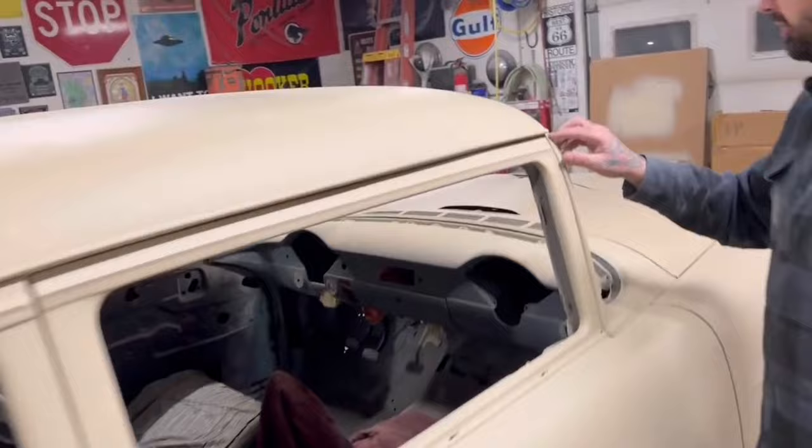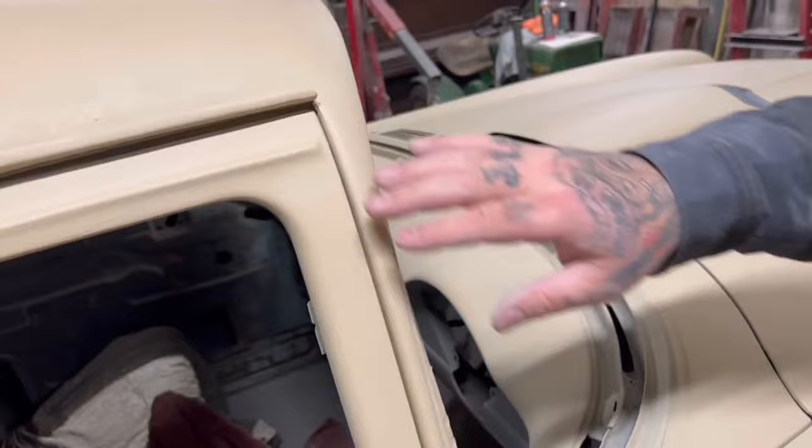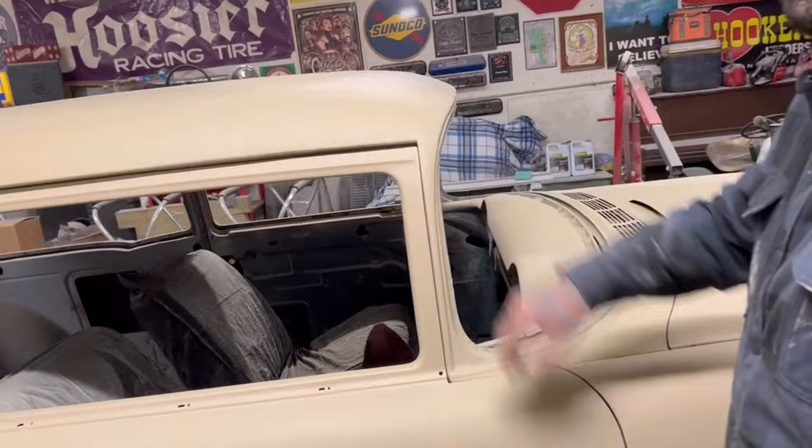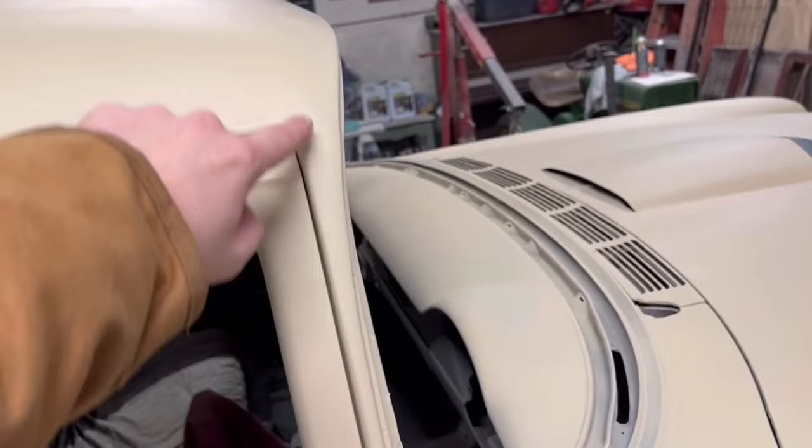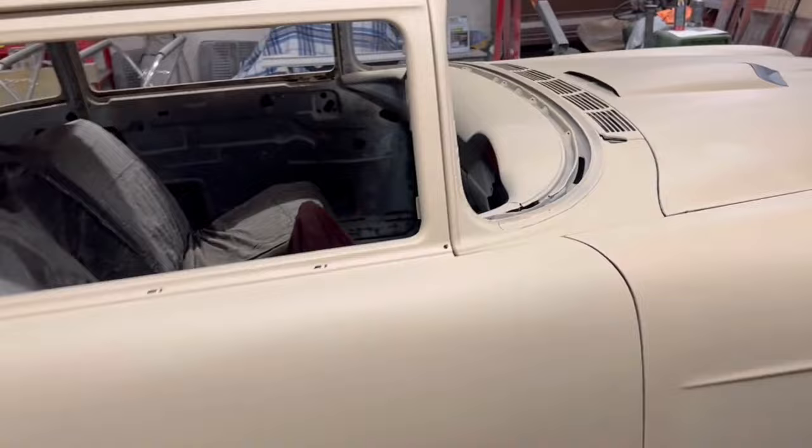I was going to ask if you were going to put a line here. Everybody that I've watched do it puts a line here, because if you get the Bel Air trim, there's a piece of chrome that covers this. I could bring it down, but if I don't find that chrome, at least it'll have a nice cutoff. I think it'll look better anyway, because it would look goofy having your roof color the same here and then your door as a hard line. My reason is that when I paint the entire car the main color, it's going to be super easy to just mask these two areas off. Then I don't have to stand on a stool to paint the roof because it's already done. I can do everything from ground level.